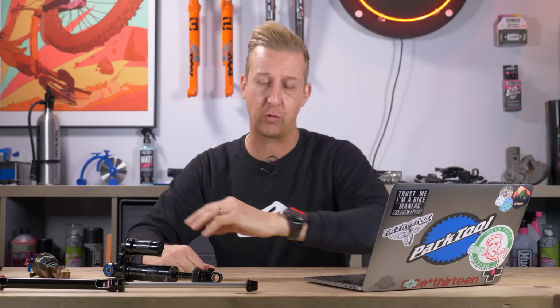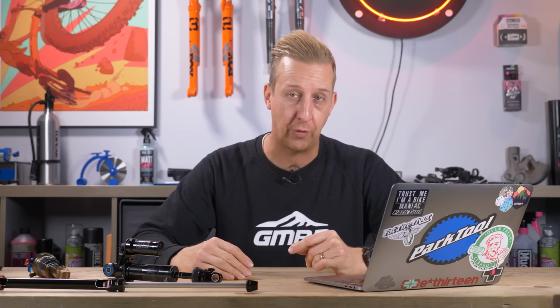So why is that? Just think about what's going on here. Aaron Gwin, I don't know his height, I don't know his weight, but if his suspension is set up as firm as some people say, it's all relative to the speed that he rides the bike at. So if you get on his bike in a car park, yeah, it may well feel very firm. But no one's going to be able to ride the bike as fast as he can. But if you were to ride a bike as fast as he can into rocks, roots, drops and stuff, suddenly that suspension is going to come to life and work correctly.